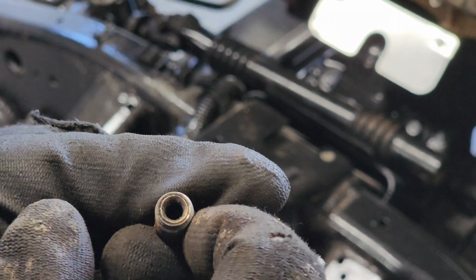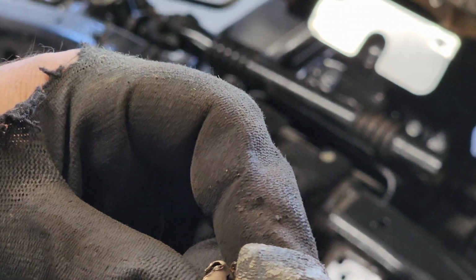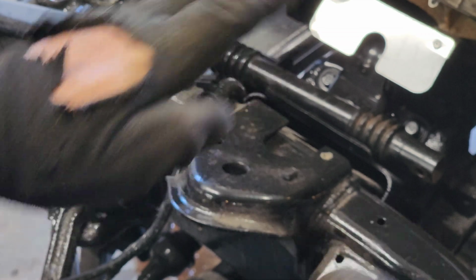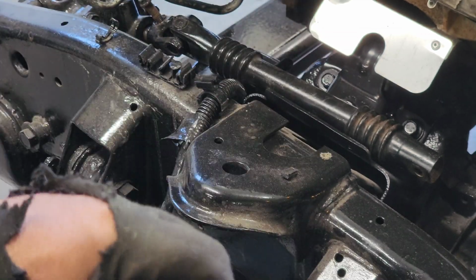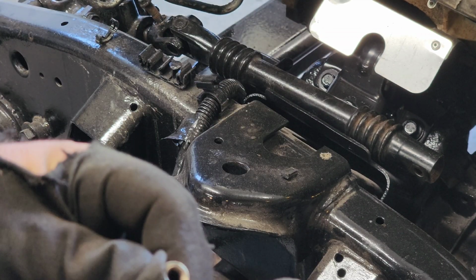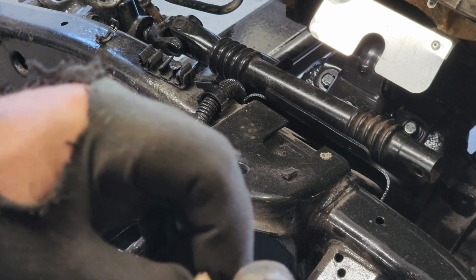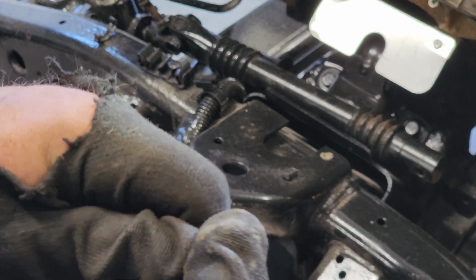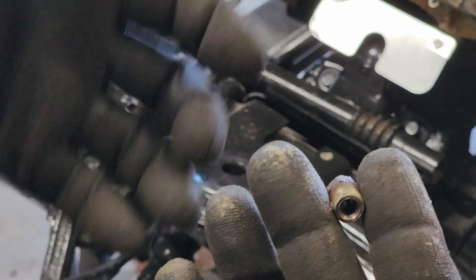But you can't really reuse them, I don't think, so much. And they're really, really weak, so yeah, you can bend them and make your bends like you're supposed to, but also they can kink really, really easy too. So I just like using the steel. It's harder to work with, but it's just more durable while you're working with it and while you're operating the vehicle.